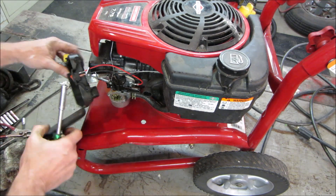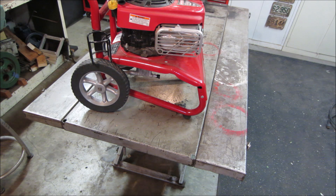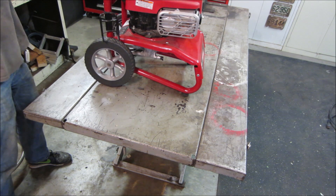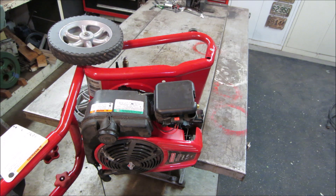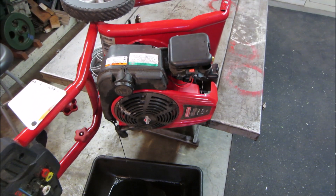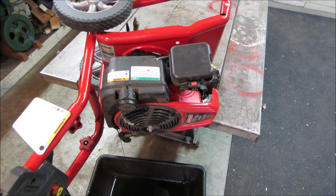One other thing: that bowl crimps down on the seal right there, so there needs to be a little bit of an air gap. This bowl actually looks like it's kind of sunk in — somebody really cranked down on it and the bowl is a little deformed; it's not pushing on the seal very well. I'm just going to tap that back out with a hammer, recess it a little bit. That's a little better — it wasn't getting a crush on that seal. You can see the gap; it'll draw right back down again when you put the nut on. It needs like a spring-loaded pre-load. There we go — I feel much better about that.